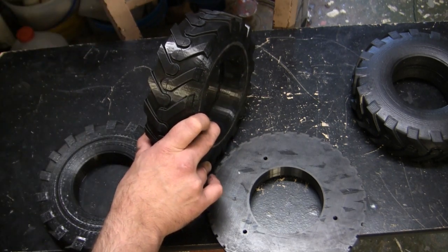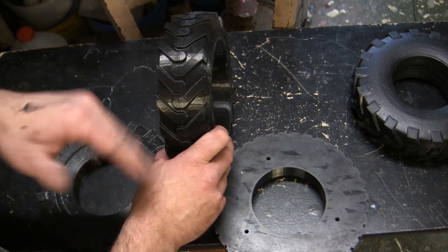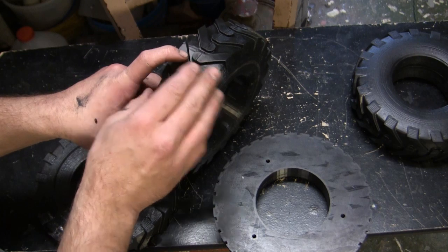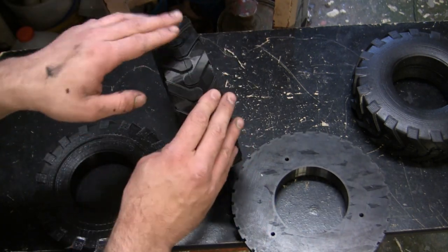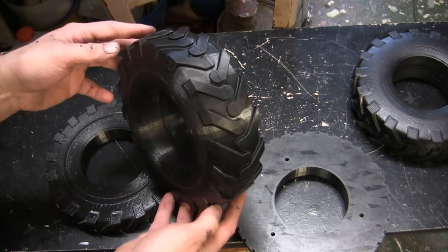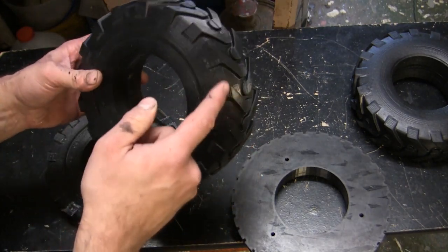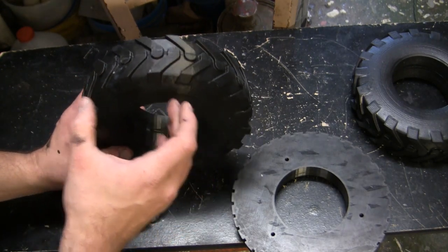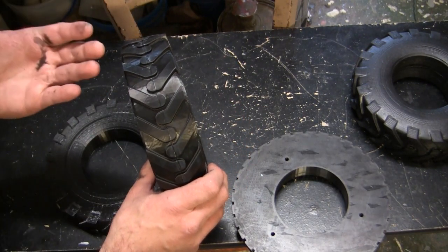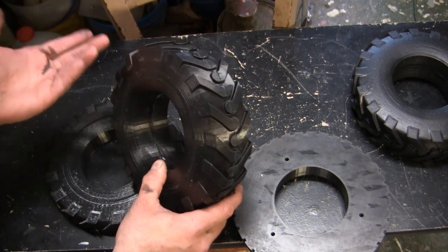Keep in mind, these vehicles don't have water jets or other propellers like those seen on the LAV-25. On the Commando, propulsion through water is done exclusively through the rotation of the tires. So they hit the drawing board to come up with a better tire solution for aquatic use. The design they came up with was the Commando Special tires, whose tread patterns resemble something you'd see on a grader or tractor, and they provided better water propulsion. In addition, the tires were very thick — designed specifically to be bulletproof, since pneumatic tires on a vehicle meant to be shot at is a concern. The Commando Special tires were very rugged and able to take basically most calibers of small arms.